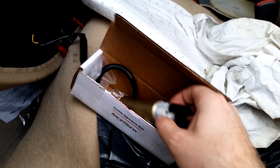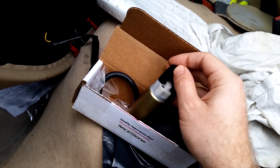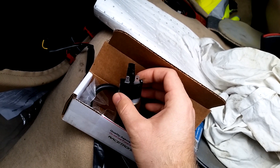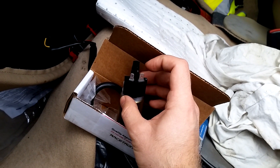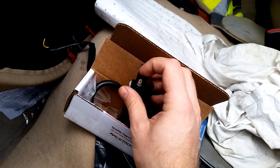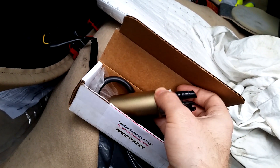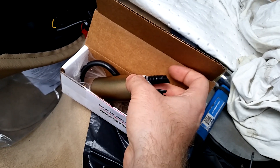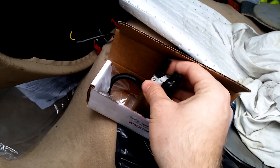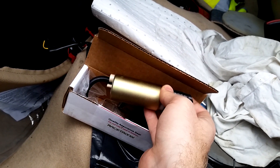So don't forget to remove the plastic cap. You'll also need a piece of flexible hose for installation — I had to cut the old hose from the fuel pump and install a new hose back to the T-connector. With the pump I also got some electrical connectors. Since the original pump has two different-size connectors and the new pump had two connectors of similar size, I had to cut one and do some electrical connection work. I also had to do some filing on the pre-filter at the bottom of the assembly, since the new pump is slightly bigger than the stock one. That was very easy — it's just plastic, you can easily make it slightly bigger and everything will fit together.